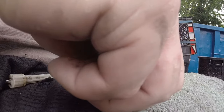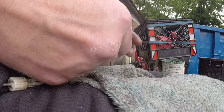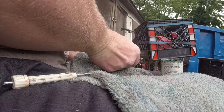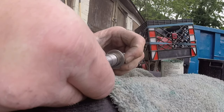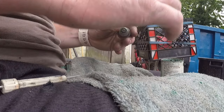So that goes in. Can you see that? See the arm? No, the hole? Arm, listen to me. The hole. So that goes in there. This goes like so. The retaining pin, that goes in next. Like so. Get that extra grease on the outside off. Okay, now the pin is in. See how this moves? This all moves when you push the clutch pedal, or handle, sorry. But the retaining pin's in there, and this will not come off unless you take that pin off, which is super simple, but necessary.